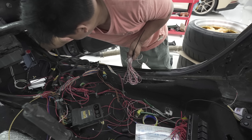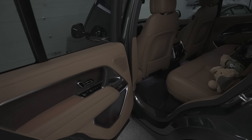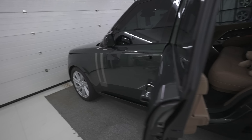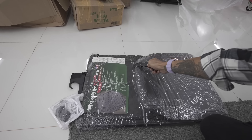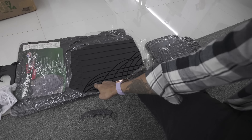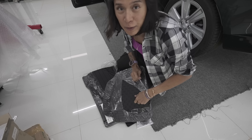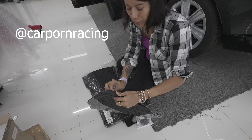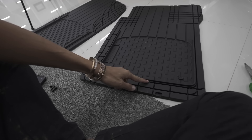So these are our water inlet lines and the hoses for oil and fuel — we're going to figure that all out. We're going to move the wiring rack system in so that we can plug it in and move the coils to the inside. We also have brand new moldings from Japan — weather strips for the doors and new seals to make everything look brand new since after wrapping the car you could see all the seals were old and baconing. Our main problem is Mad Mike has no air conditioner, so he had his plate mounted there because he has right-hand drive, which means we're going to have some wiring issues.